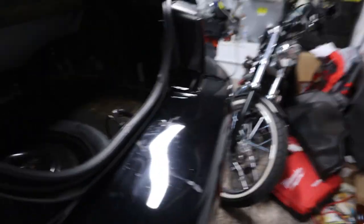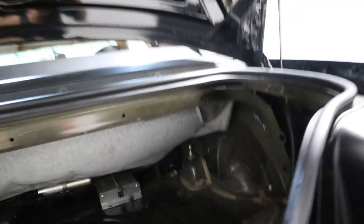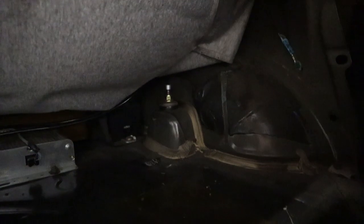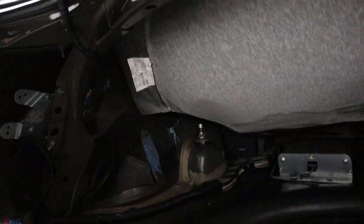Okay guys, now that you have your wheels off and your car on jack stands, you're going to have to remove your panels from the interior of your trunk. These are the bolts for the rear shocks — there's one, and there's the other. And there's my convertible top motor. If you have a coupe, you're not going to have that. But that's where the top bolts for the shocks are located, so you're going to want access to that first.